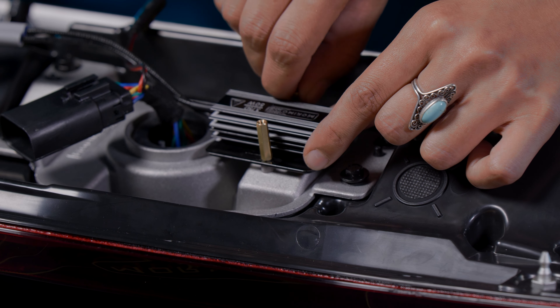For the 2017 to 2019 OEM LED taillight, it is the easiest install, but there's one thing we want you to double check. First things first, go ahead and remove the bracket off the back side of your XB taillight — there are four 7mm screws that you'll be removing. Once removed, go ahead and locate the purple to red wire. For example, on this one it is already connected from the purple to yellow. Go ahead and disconnect that and connect the purple to red, and then you're good to go. Now just take your Bliss system and reinstall it into your Morimoto bracket, and reinstall that bracket back to your taillight — your install is ready to go into your Super Duty.